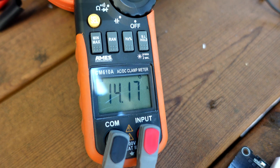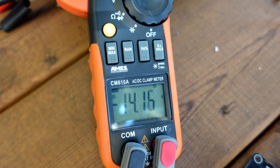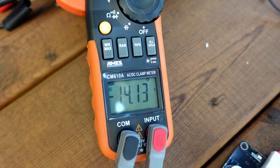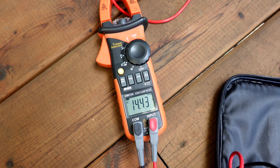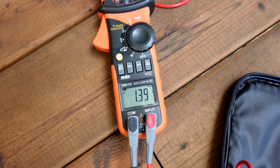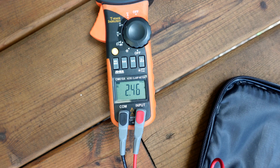There are probably other people wondering how long it would last. On initial startup this thing uses quite a bit more power. With an amp meter, it uses somewhere between 14 and 15 amps during the ignition phase to get everything fired up. Once the barbecue is on and the igniter turns off, it's using between one and a half and two and a half amps. The extra amp is when the auger is feeding in more pellets; otherwise just running the fan is about one and a half amps — so roughly two amps average.